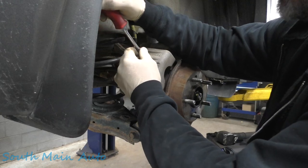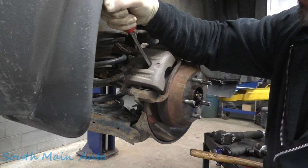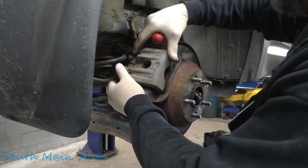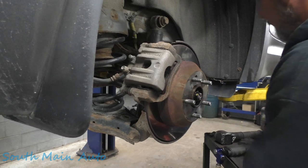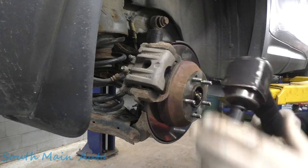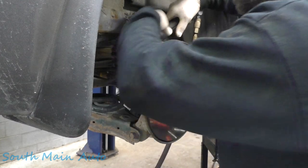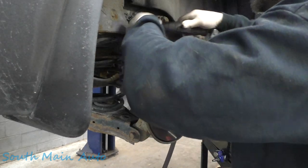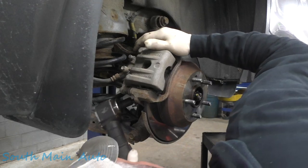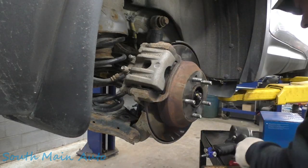See if we can spread the caliper back here just a little bit — just put the screwdriver in there between the pad and the caliper and hold a little tension on it. They look relatively new so I doubt they'll loosen up much. We're going to give it the classic reach-around 14mm swivel. We're going to pull the whole caliper and bracket as an assembly — bolt on the top and on the bottom. Thought the swivel would help us clear the spring but clearly not; we need a bit of an extension.